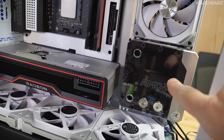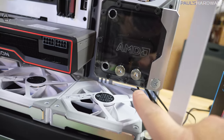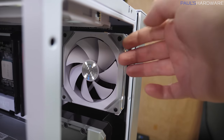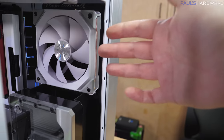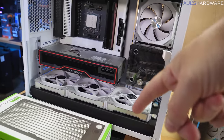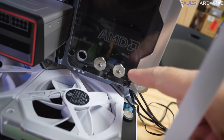Here's my plan: I'm keeping the reservoir in its current position at the bottom. I considered moving it up for better access to plugs and inlets, but I think I have the loop figured out. I'm going to flip one fan to be an intake on the side, and put a couple of kit fans behind the front panel as filtered intakes. That gives us two intakes with rads on the side, three intakes with rads at the front, and four unrestricted exhausts — a reasonable airflow balance.